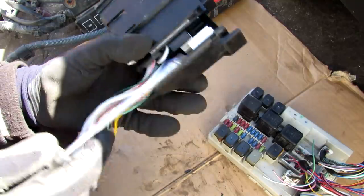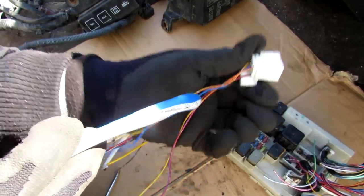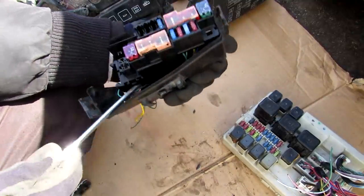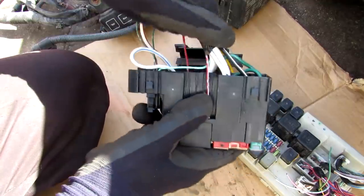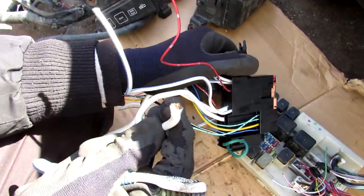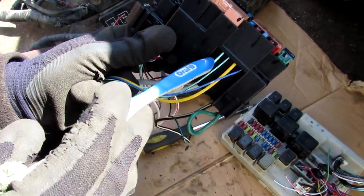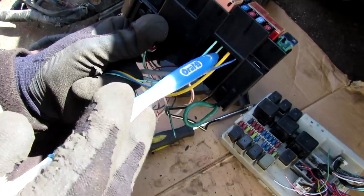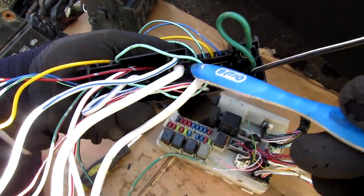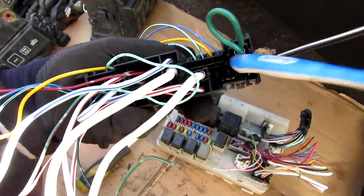Removing the cover, you can see we've got an electromagnet inside that gets powered up by your ECU signal, which sucks in a contact arm allowing the contacts to connect. The physically separated circuits then allow your light bulb to turn on. These terminals and contacts can sometimes be replaced if they get burnt out. Essentially, the thicker the wire, the more current it carries — you can see that 15 amp fuses carry slightly thicker wires compared to 10 amp fuses, and there's a common positive rail running along the inside powering all the smaller fuses.